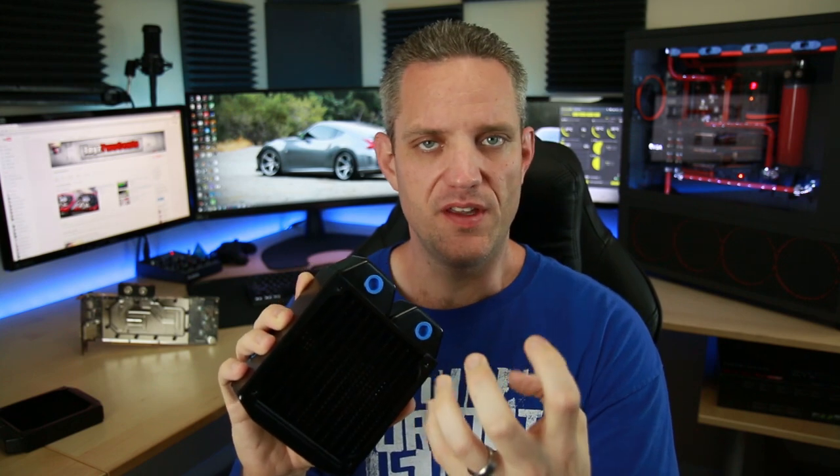Some would say 60mm or even 80mm is where you'd need push-pull, not necessarily 45mm — it also depends on fin density, how small or big the fins are. There are a lot of factors, and I did a video on that which goes more in depth. Today we're going to keep it high level and simple for the sake of an apples-to-apples comparison.